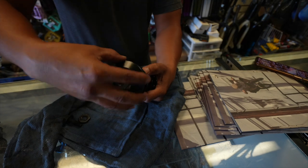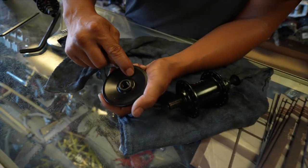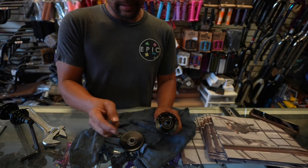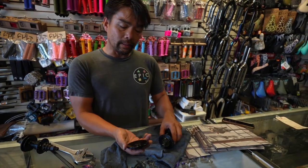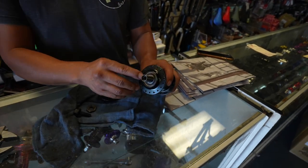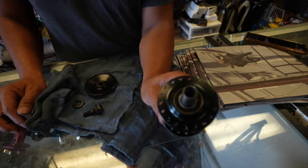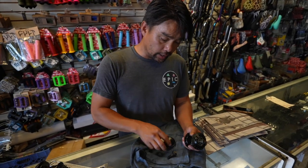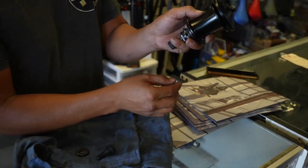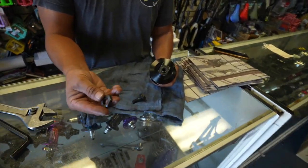Put it on the grinder and then put this back on and check to see if it still hits. If it's still hitting and you've already ground down so much, you got to go in for surgery — get yourself a grinder or a Dremel and grind this part out. Don't touch the little cone part; grind this little part right here because this is what's hitting this. Then keep going back to check if it clears. Sometimes there's a little lip that forms and it's hitting the spoke — grind that down. After you do that, look how dirty it is. While you're in here, why not? Get a rag — notice I'm not using any kind of cleaner — look how clean that is. Don't spray any cleaner in there, just wipe it down because it's a steel bearing. Put this back together — look how well that screws on. If it clears, you did good. If not, go in there and grind or file it out a little bit more. Reassemble — neutral side out, screw it back on, all the threads good.